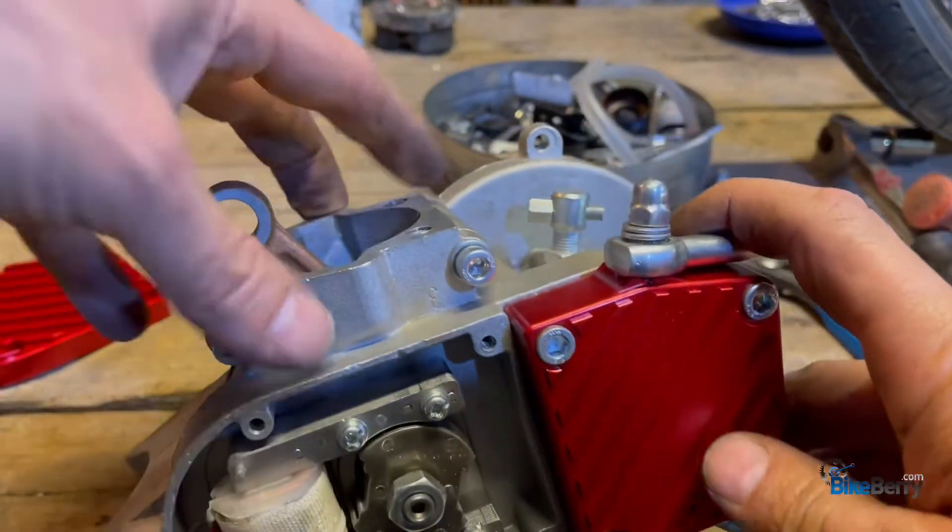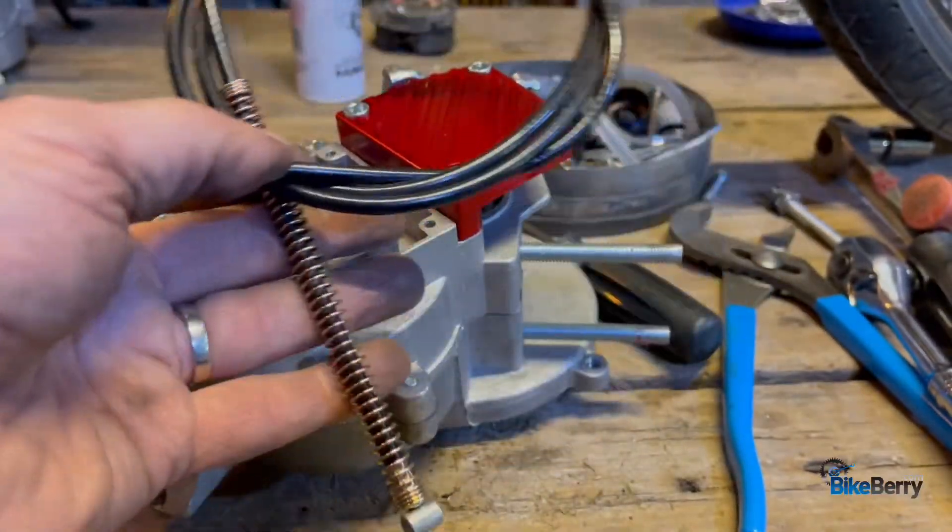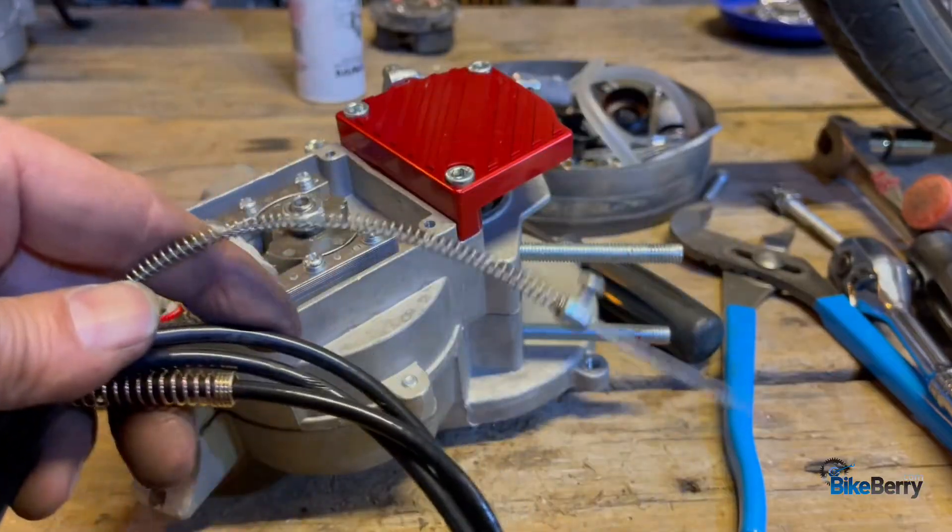Get all your covers back on, get your top end back on. Then when you reconnect your clutch, you can get a new clutch cable in there. Throw this sucker on there and you'll be riding good. There you have it — a whole new clutch assembly, all fresh and good to go. In future videos we're going to go into specific things and upgrades you can have with your clutch, so be on the lookout for that in the coming weeks. Let me know in the comments below if this video helped you, because I never really found good instruction on this and I had a lot of trial and error to figure it out. Subscribe to the channel — we've got a lot of good content coming out this summer. Until next time, let's roll.